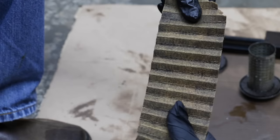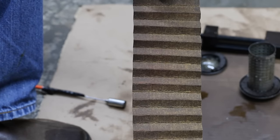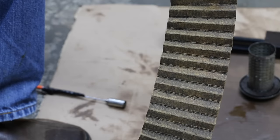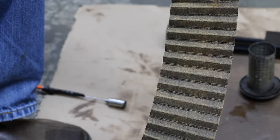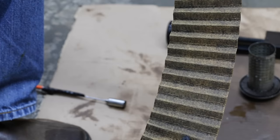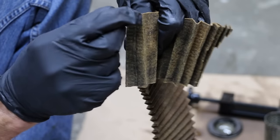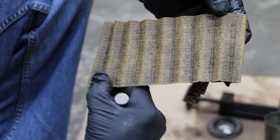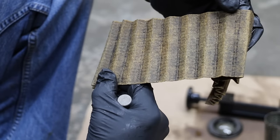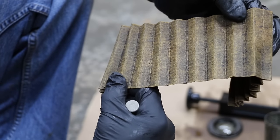This towel is pretty saturated from all the oil — draining the oil out of this filter was a very good idea. This side of the filter was collecting contamination; this is the inside, the clean side. As you can tell, this filter collected a lot of contamination. I believe what happened is the Seafoam did a great job of breaking loose a lot of sludge and built-up contamination, and as a result this filter collected a lot of it. What I need to do in the future is use Seafoam again a time or two to continue breaking loose the sludge and remove as much as possible, so the engine will have good oil flow. This appears to be engine sludge — it's not coming loose on the magnet. My assumption is that this is mainly sludge that's been built up in the engine for many years that Seafoam has helped break free.